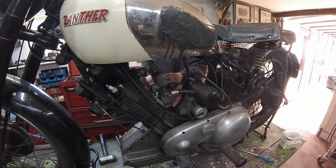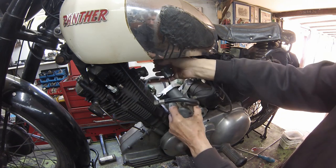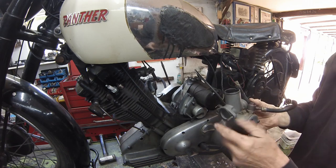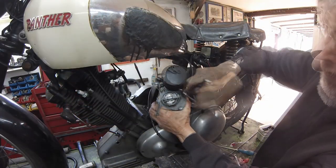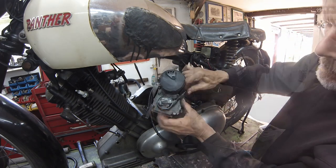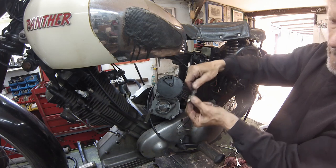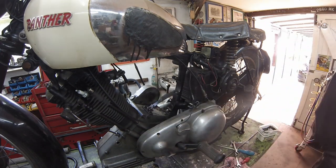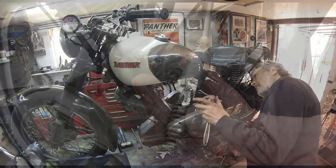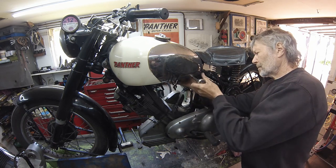Putting the bits into stacking kitchen spread tubs will make life simpler when the rebuild gets underway. The Lucas M01 magneto with its piggyback dynamo is held with a strap and pinch bolt. Draw them clear of the Oldham coupling and slip the cable nipple free at the handlebar control to give some additional slack. Slide the rubber boot up the cable and unscrew the advance retard housing from the magneto end plate. Keep an eye out for the return spring hiding inside. It's a more determined escapee than Houdini, and better camouflaged than a chameleon once it hides under the bench.